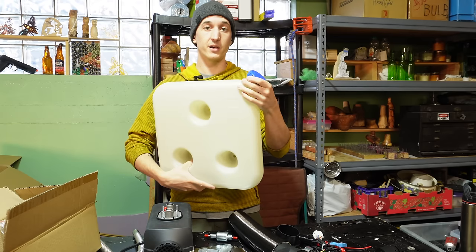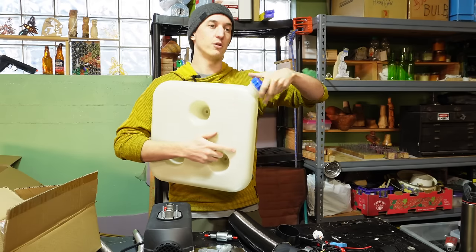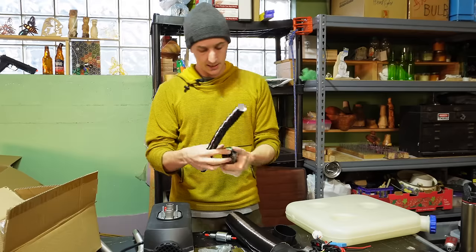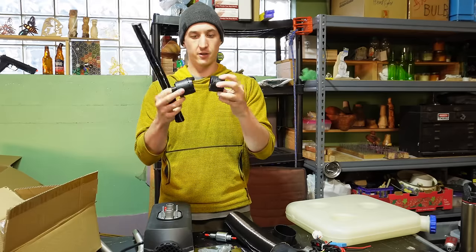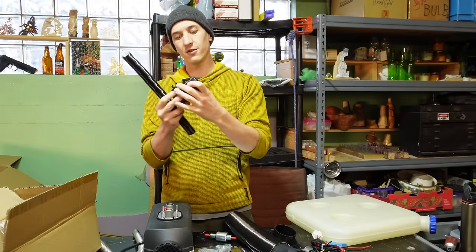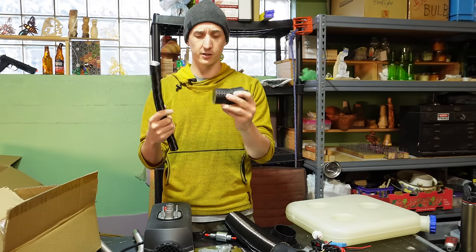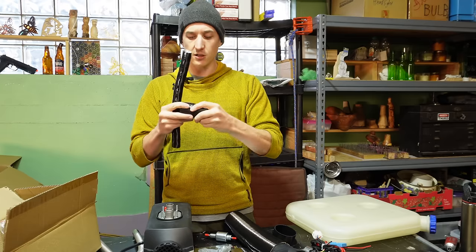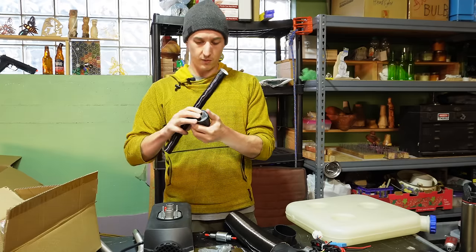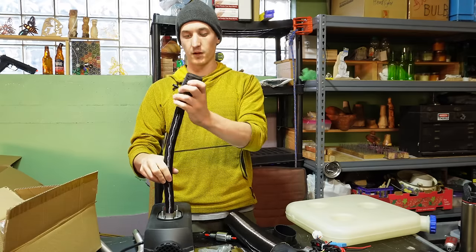But I would also recommend not filling up this tank all the way, because if fuel is sloshing against the cap all the time, you are gonna get some smells, even with that breather, I think. And then we've got the intake. It came with this intake silencer. These do actually reduce the sound of the intake, and they kind of work. They're not actually filters, but they prevent large particles from being sucked into the intake. So I think it's good to use these, and this is one of the cheapest ones I've ever seen. It's super lightweight, but it's still probably better than nothing, and that just goes right on the intake there.